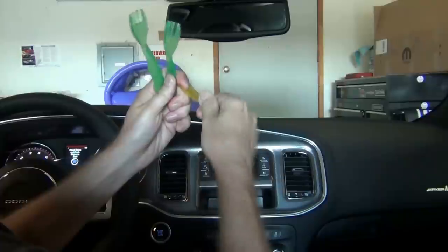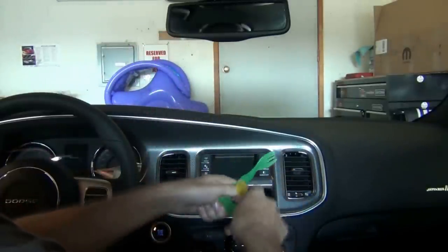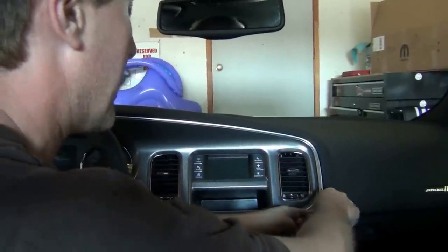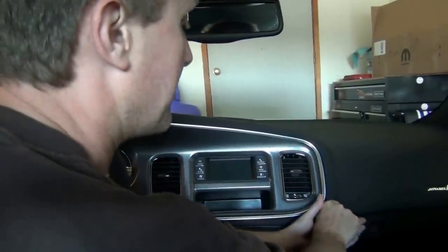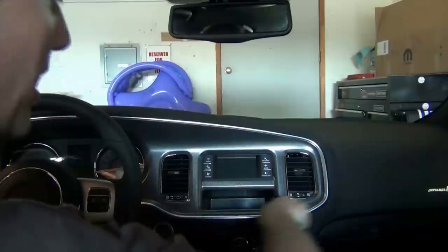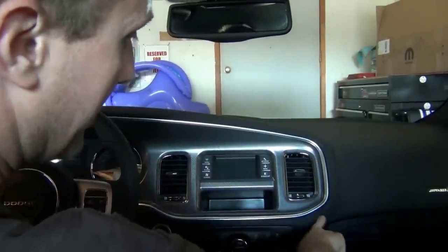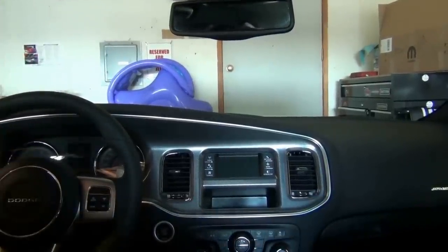The fork is a lot stiffer than the knife, especially the back end — really stiff. I started in this corner and used three forks together for combined pressure and popped one side out. You need something really stiff to do this. I'm going extra slow so it doesn't damage anything. Let me see if I can get this bezel off.